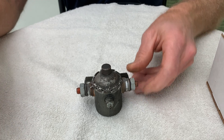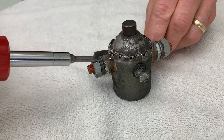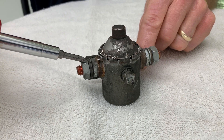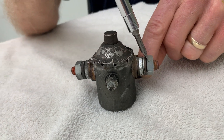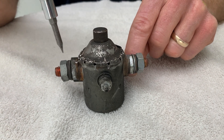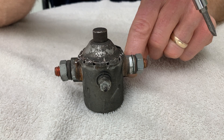Imagine on this side when you have a large wire attached here, you have battery power applied here — in this case it was a 12-volt battery, so you've got 12 volts ready here for whenever it's needed. Unless you activate the starter switch, that power cannot make it over to this side. Think of this contactor as an electrical gate — most of the time closed, and when you open the gate, power from this terminal goes straight through to this terminal and out to the starter.